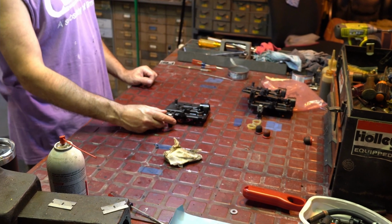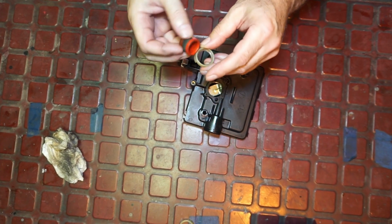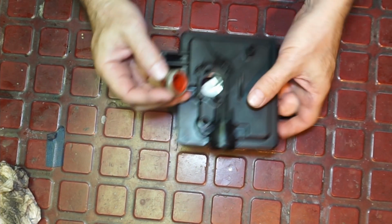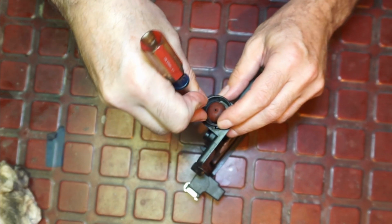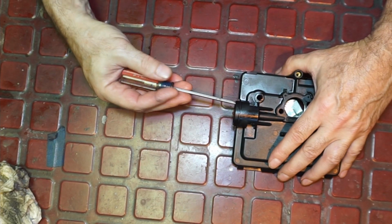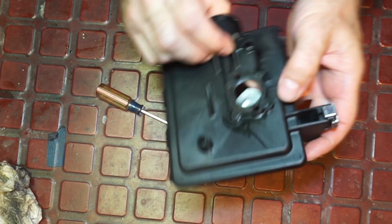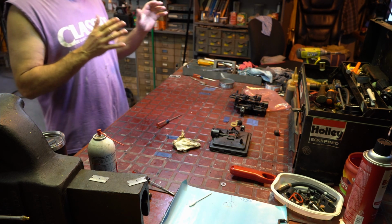All right, now the thankless part of the job is done. So we can put these guys back, all nice and clean in there, right? It's certainly clean enough. Now, gotta hold it like this, okay? Line up the keys again. And then stick a screwdriver in there to try to pop them back down again. If you push them here, you're gonna dislodge the bulb and it won't work. It's on. Done. Clean. Okay. We'll do the others and we'll get to the most important part.